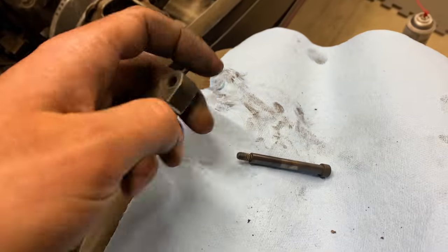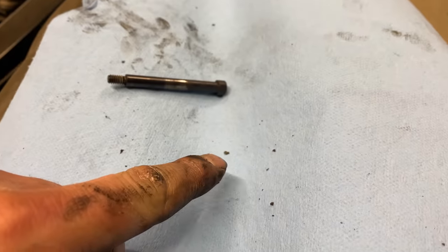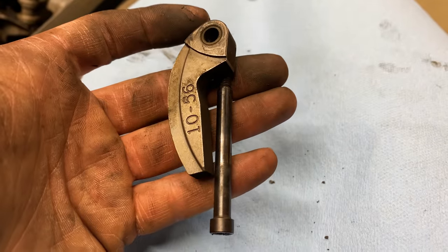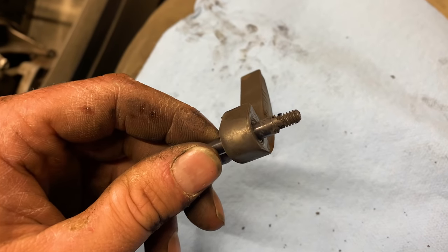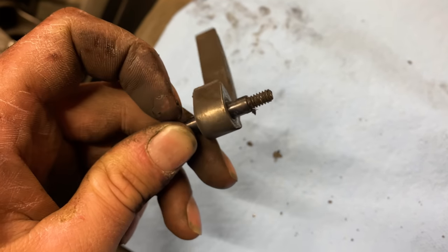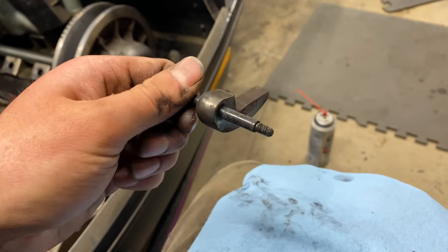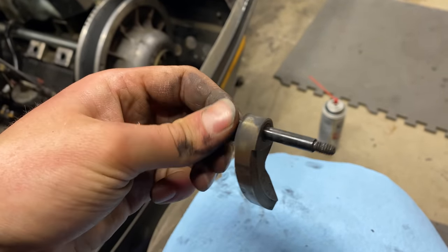Over in the clutch, we're taking out weights. I'm glad I'm doing it because some of the weights were kind of stuck with the pin — when I'd spin the pin, the weight would spin too. When I got the weights out, you can see all this crap, the dust and dirt that was in here in the bushing, pushed up against the roller and just not allowing it to spin. Now we're getting out that dirt and they're spinning really nice and freely on the pin. It's all bound up together as one unit. You can see the gunk on the threads — just push the pin through and push out this dirt. Once cleaned, I can spin the whole thing in my hand and the weight will not go with it. That's what we want.